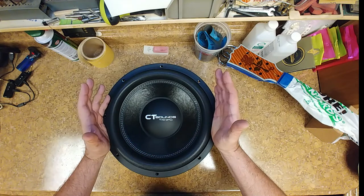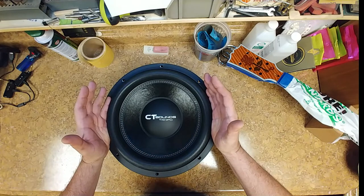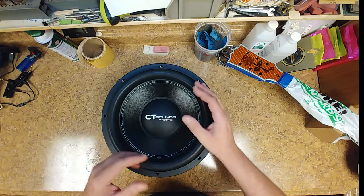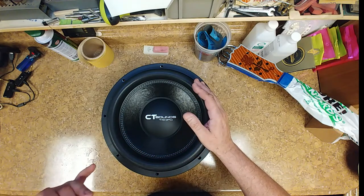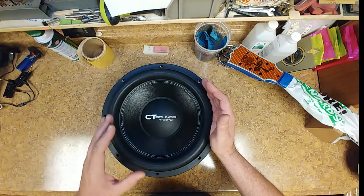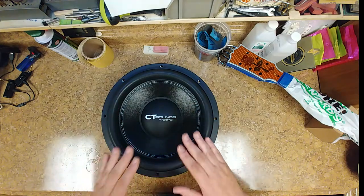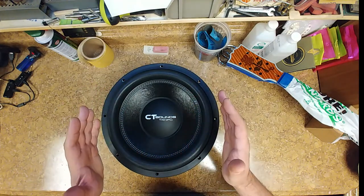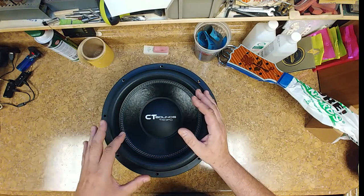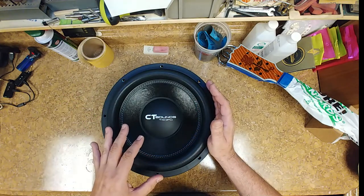So now I'm going to be pushing a little bit of air here. This is the 12-inch CT Sounds, 650-watt RMS, 1,300 watts peak. And remember, it took 1,300 watts to blow this thing up. Maybe the Pioneer took a little bit more at peak, but this is going to handle continuous wattage without overheating — at least that's what it's supposed to do if this is a true subwoofer. The reviews on this thing were very nice, and I'm going to be able to just throw this inside the enclosure I already have without having to make a new one. The specs between this driver and the enclosure are pretty damn close, so I should be tuned properly.